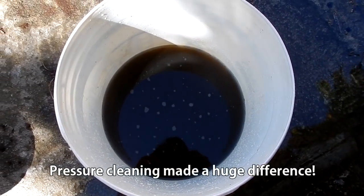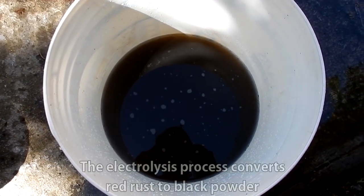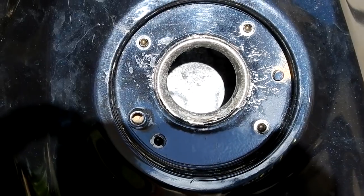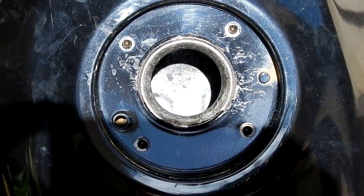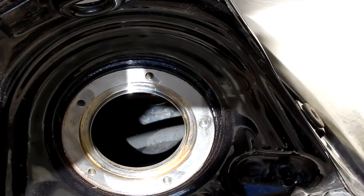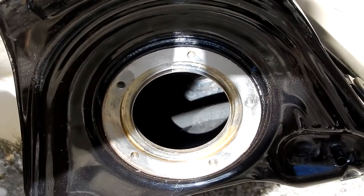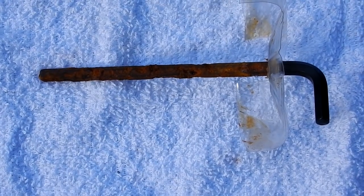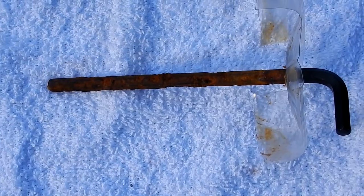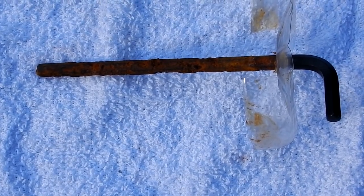The tank has come out really a lot cleaner, and I don't think we're going to have to do much more to it, but we'll do one more blast with the pressure sprayer. We got a lot of dark black muck out of the tank. Here's a better shot of the inside of the tank in the sunshine — you remember how rusty it was before, now look at it. Another look inside from where the fuel injector pump goes — look how clean it is. As a final note, this is what two and a half days of electrolysis does to the Allen wrench I used as the anode: it is completely rusted in the area that was submerged in the solution.